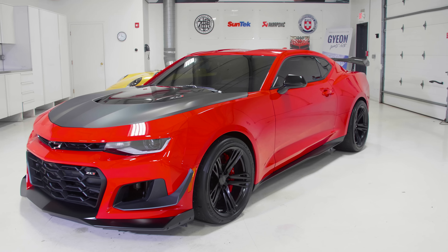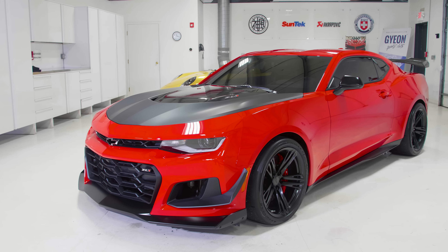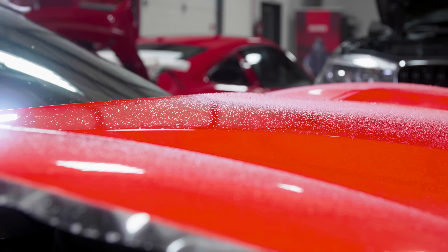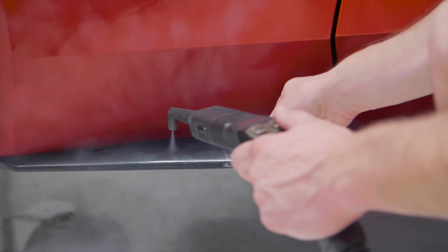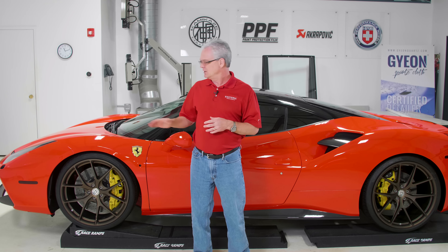As the years went on and as the cars went on, I started doing more and more film. The film was looking better, easier to work with, easier to maintain. My latest brand new car, I'm going to wrap the entire vehicle. Maintenance is really easy — it's got a nice hydrophobic top coat, so basically coating is built into the film. It looks fantastic; I can go out to track days and not worry about it. If it gets some heavier hits at the end of the season, I'll pull it off and put some fresh paint protection film on. At car shows, I'm not worried about a tiny little swirl I might have gotten. It's not going to swirl up or scratch as bad as paint, and it's also self-healing to a certain extent. We've seen scuffs or marks from the wrong kind of rag — hit it with a heat gun and all those marks go away.